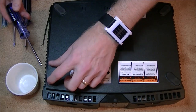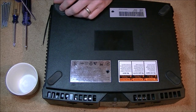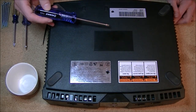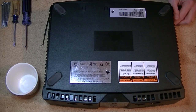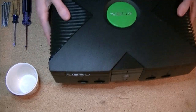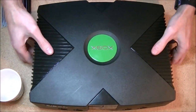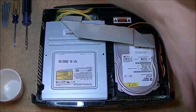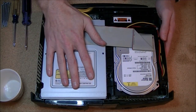I've already removed the six large screws on the bottom of the console, but I'll show you where they go. You'll need the T20 for these screws — they're located in six places, all under the feet on the outside edge, so you will have to pry up the feet of your device. There are also two inside the stickers, which is why that other guy didn't want to put holes in his. Once you remove all six, flip the device back over, be careful because the top will now be loose, and gently lift it off — it just lifts straight up.